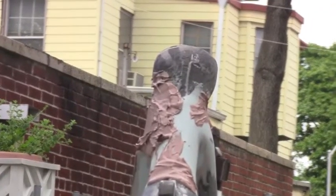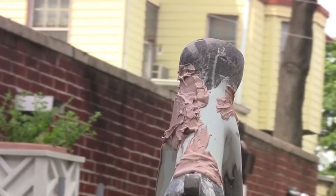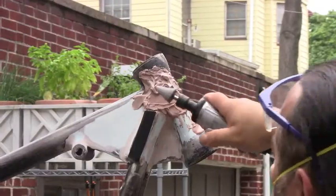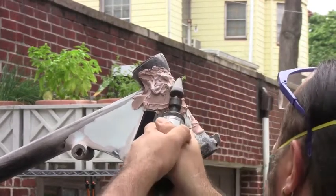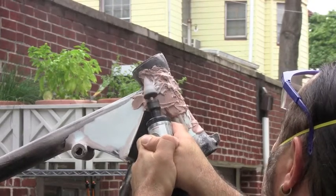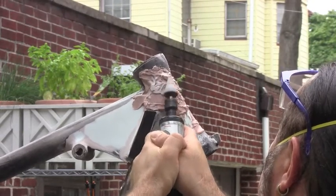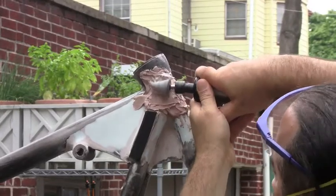You can see here after two or three coats, we've built up a nice thick area and it's almost even with the other side. At this point I like to take out the power tools again — this is a die grinder. I put on a medium grade bit and just start sanding, taking out all the ridges, getting it as smooth as possible so you can finish up with hand sanding and maybe another coat or two of the finishing Bondo.